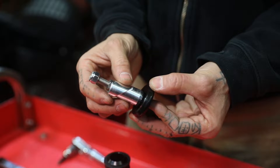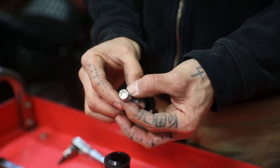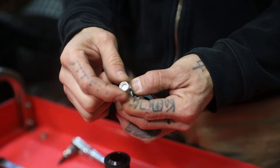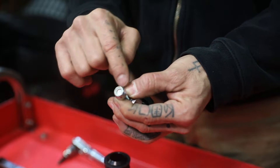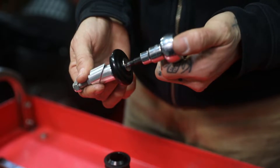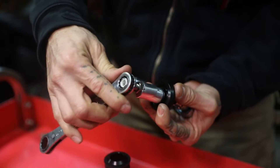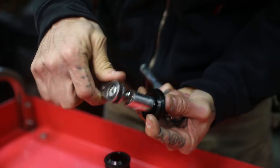Once you have your bar end wedge mechanism removed from your LumaCore grip, there's one thing we need to do before the installation. We need to have this nylock properly installed on the end of this bolt. You can see here this nylock is just finger tight. I want this nylock to where at least one thread from this bolt is exposed. So just take your 3/16 Allen and your half-inch wrench and tighten that nylock until at least one thread is exposed.